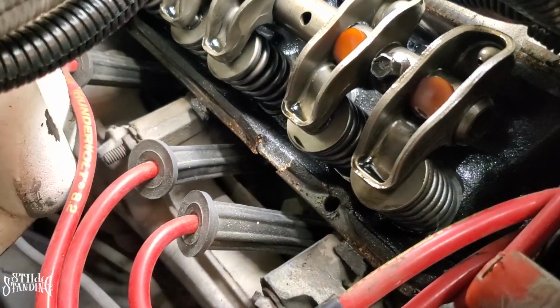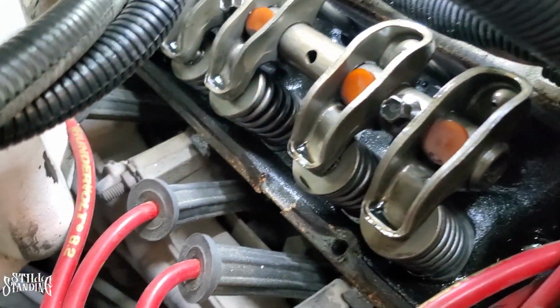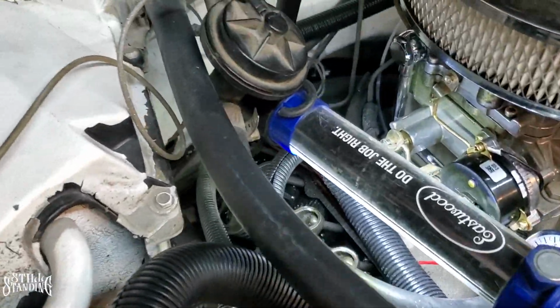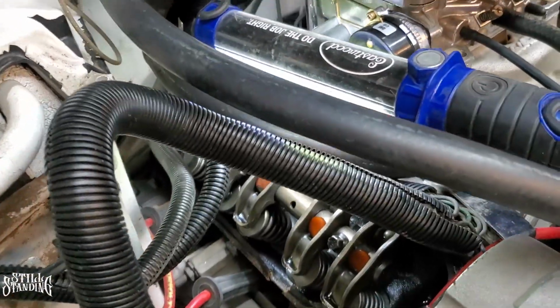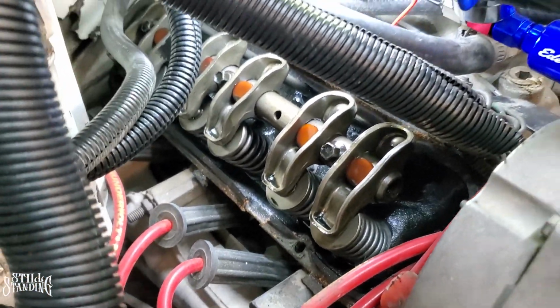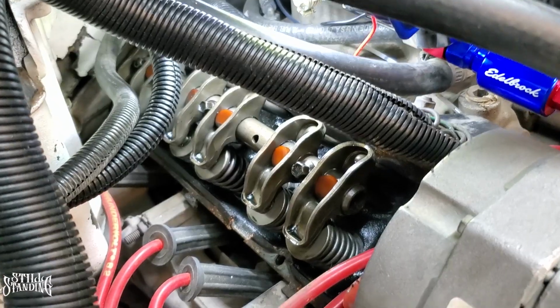And this little piece right here. So it's all going to come off like that, scrape it off, and then get around all this stuff that's here to try to get it completely off. And then we can put on the new valve cover gasket. All it takes is patience and time. So let me do that real quick. I'll bring you guys back on. And there it is.